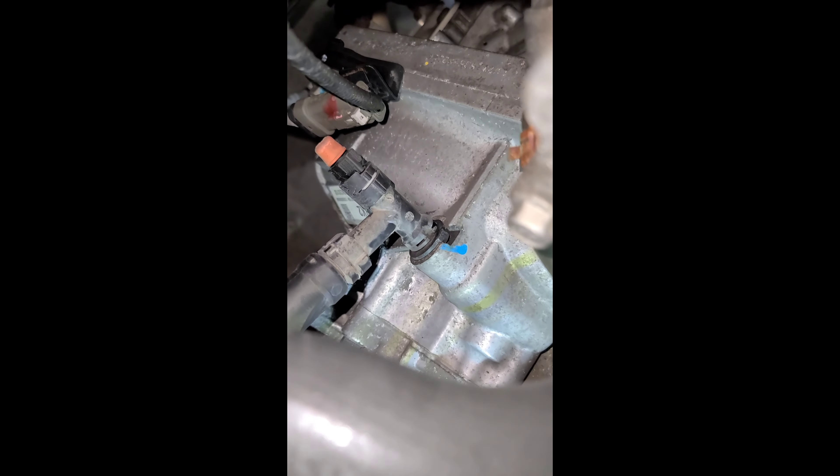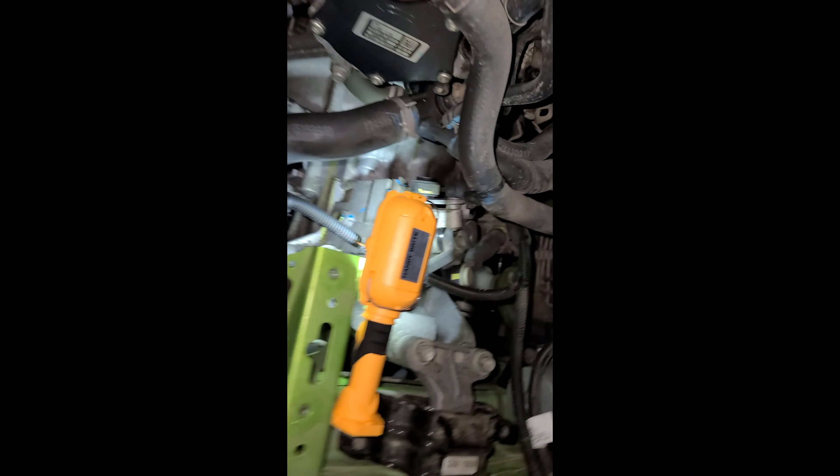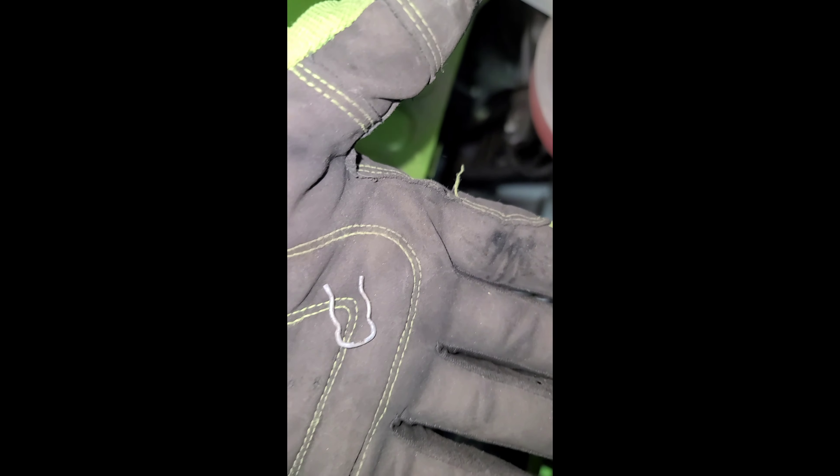That guy's got a little metal clip right there — there was one by that blue line. I just stuck a little screwdriver in that little valley and popped the clip right out. Here's the clip — twist it and it pops right out. Put that hose up out of the way and just stuff it right there. And that's your slave cylinder.